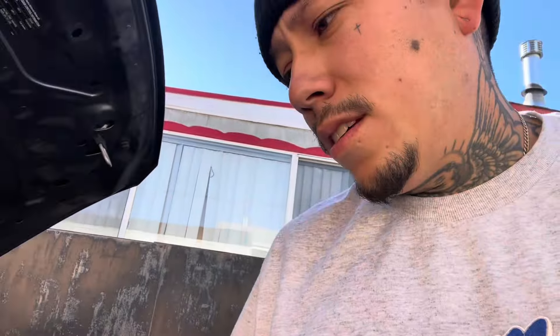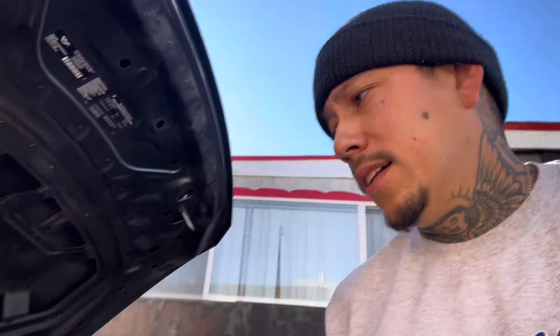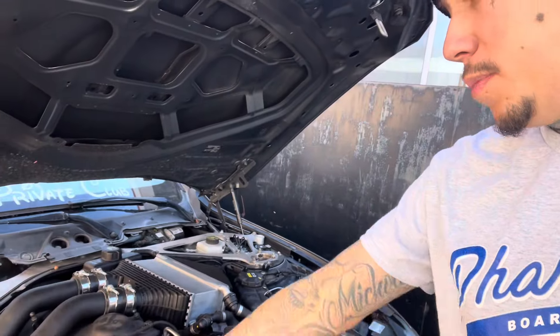I love when this thing breaks. The valve cover went out — the PCV valve, this little valve here. I don't know why BMW invented something like that, but when your car starts whistling or making a sound like a belt, you put your ear on it and you pretty much know you've got to replace the whole valve cover. That's what I'm going to do.